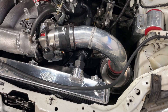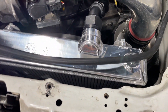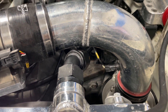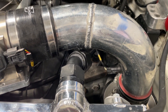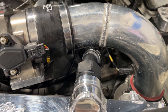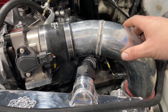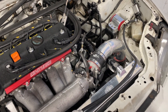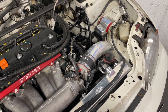This setup, although it's free flowing, the issue is with all this hot air it's going to kill power. Also, with the fan blowing hot air on the air temp sensor, the sensor gets actually hotter than it should be reading, and the ECU doesn't like that — it pulls timing, adds fuel, and messes up the tune. So what we did was disconnect it and stick the intake up out of the hood so it was getting nice airflow. That dropped intake temps from 140 degrees down to basically the 74-degree ambient temperature in the shop.